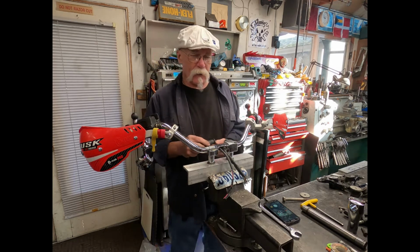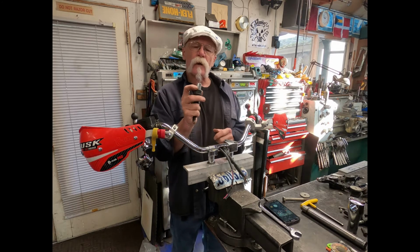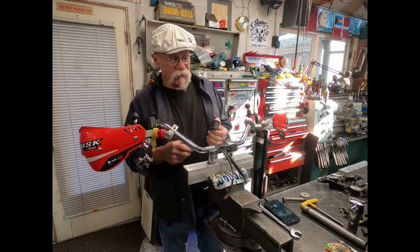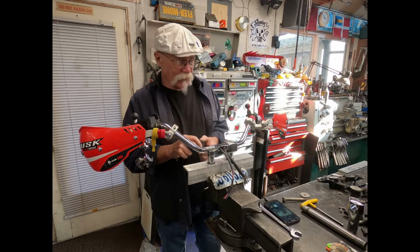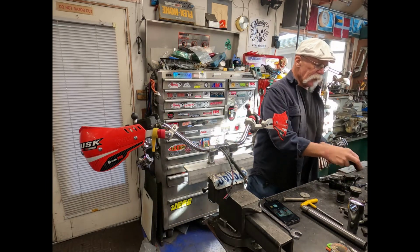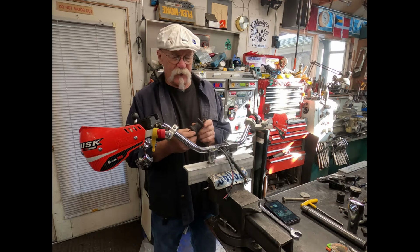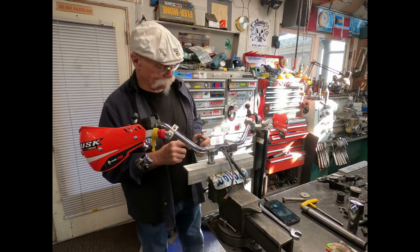One thing I do like about the Sportster style riser shocks is that there's a piece of metal in there, and when this gets clamped down, it's rigid, but at the same time you've got the shock absorption of the rubbers itself. On the standard Yamaha, basically all they're doing is using flat washers and stuff, and then this fits down inside, but there is no metal or anything in there.